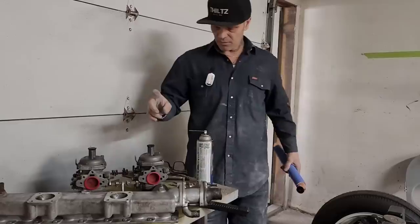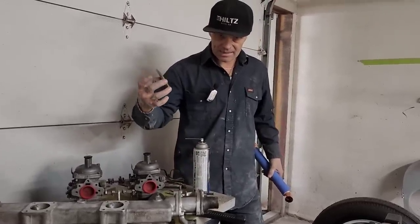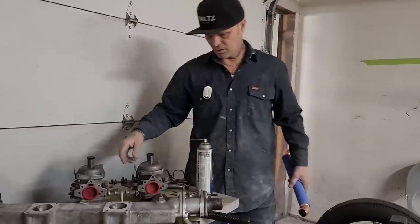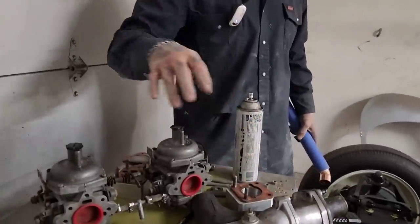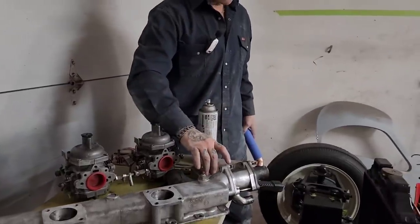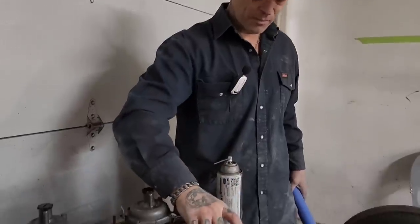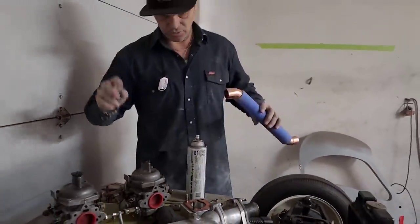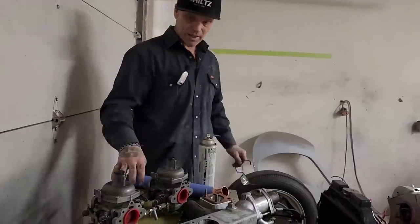I learned a couple things from people talking on the internet. These little pieces here would keep the heat from the carburetor to stop it from vapor locking. So the heat from the aluminum would travel through that piece of aluminum, go to the carburetor, and maybe heat up the fuel and vapor lock the carburation system so it does not start again. So I'm thinking that these thick carburetor gaskets stop it from vapor locking. I can remember people cutting wood and making a system like that so their carburetor stopped vapor locking. I think I probably will put them back in just in case.